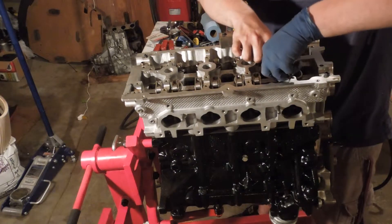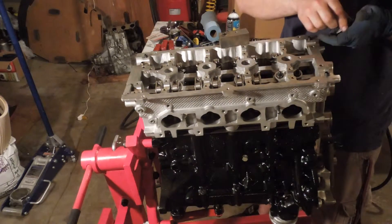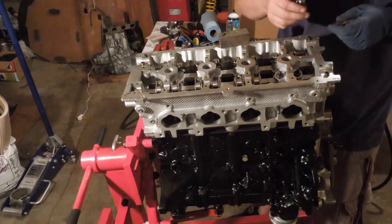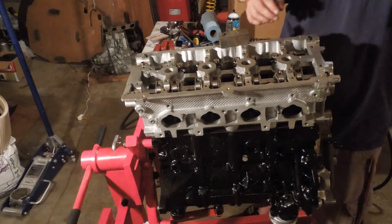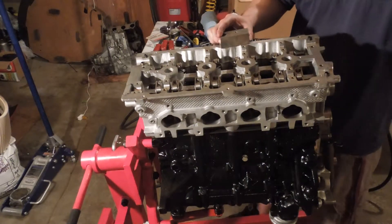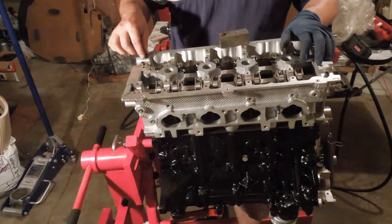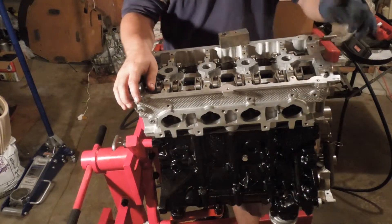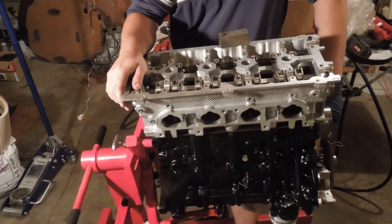The nice thing about these solid lifters — they're from an SRT-4. The heads are practically identical in parts, but the way the oil passages and galleys meet up is a little bit different — you'll want to watch out for that. I had a PT Cruiser do that to me with a brand new short block, and the oil passages didn't line up, so it was leaking like a sieve. That wasn't fun at all.